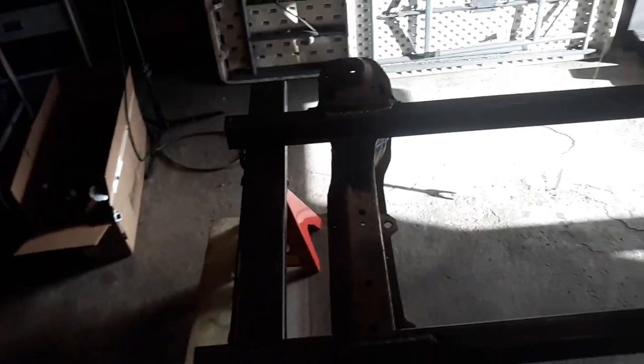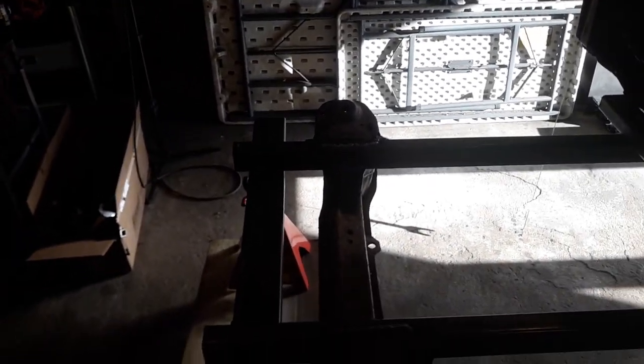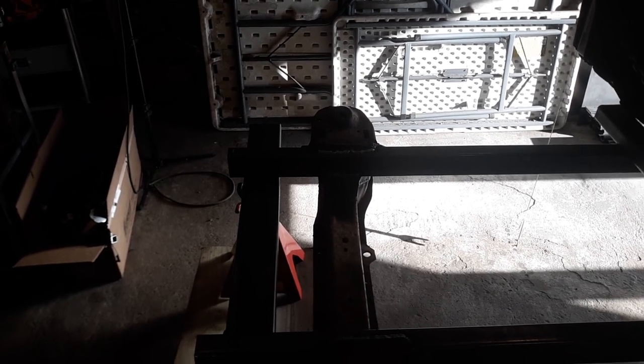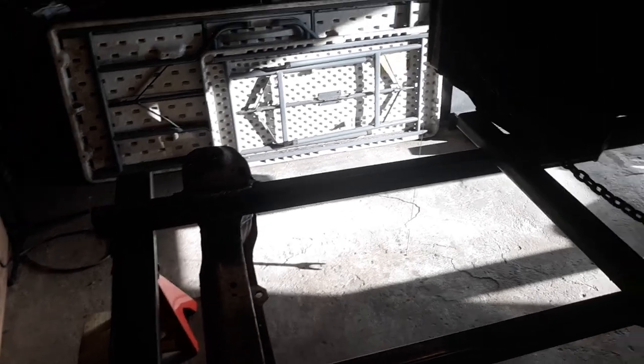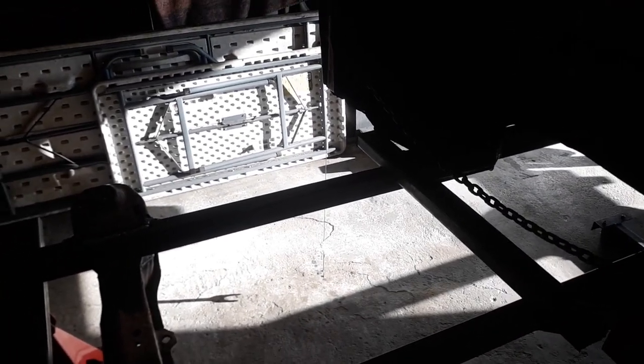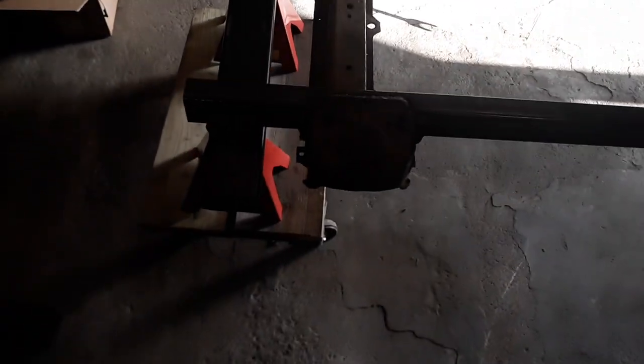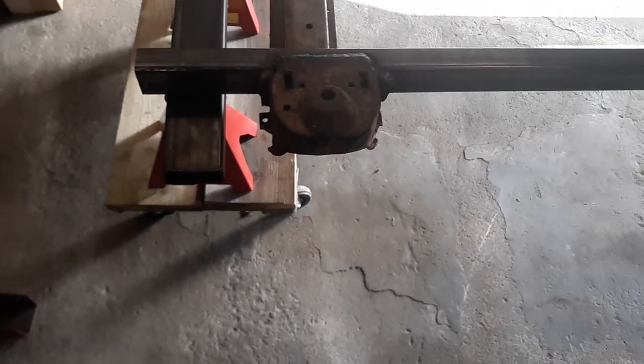Well, like I say, then in the front, and actually, I should have put that on there, dummy, you guys could see that. I'm putting a 32 grill shell in this thing, and 32 radiator and all that stuff. But not the chop one, the tall one. You know, the factory one, I should say. Not the 17-inch tall one. Because this thing isn't going to be super lowered to the ground or nothing. It's going to run stock spindles, Mustang 2 spindles in the front.